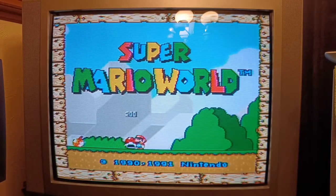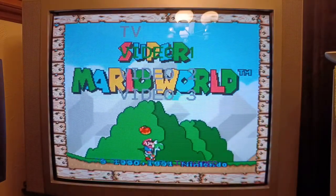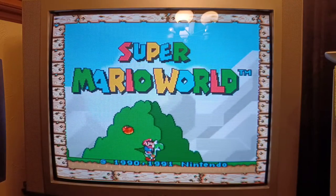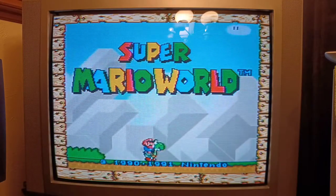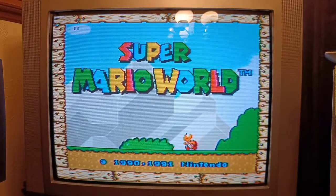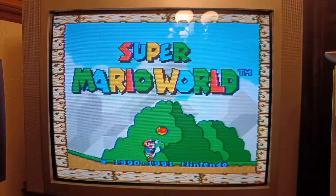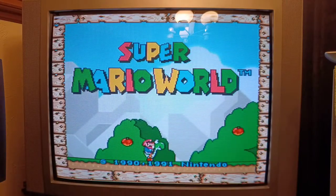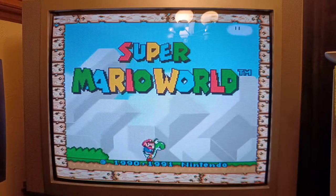Now I have S-video hooked up. S-video and composite were both connected to Video 1, so hit the input on your remote until you get to Video 1. As you can see, the image cleared up and looks way sharper — that's S-video. RF was a little blurry and actually sounds quieter because it has to decode all the colors and sound from one feed. Switching to S-video with stereo — colors and sound both improve.